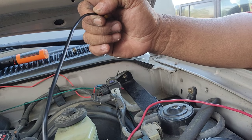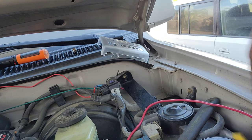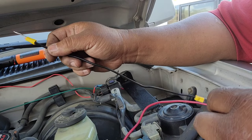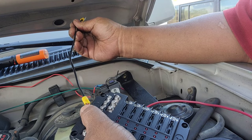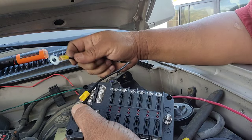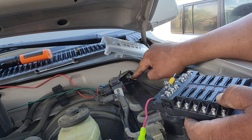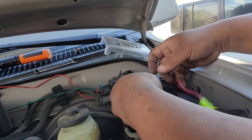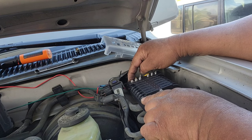I fabricated a bracket for here — this is where I'm going to be mounting my fuse box. I've made a ground wire that'll go into my fuse box like this. This part is going to be mounted right here, so I'll have a full ground. I connected the ground to the frame of my car here, and now I'm going to screw the fuse box on so it'll become one with the car.